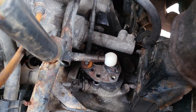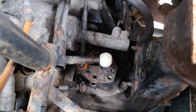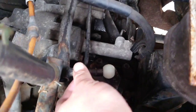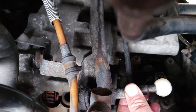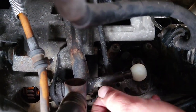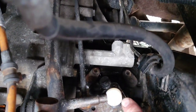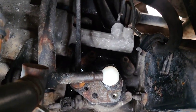The clevis is held on with two 10mm bolts, and then I was able to just slide that new ball on there — not really very difficult at all. I'm going to leave the other end; there's hardly any movement in it, and I did replace it not that long ago. Next thing now is just put that new clevis back on — I've cleaned the bolts up, and that should be that.